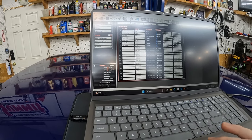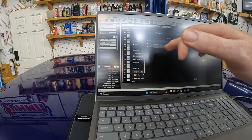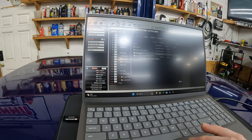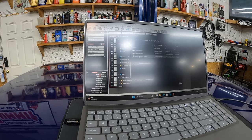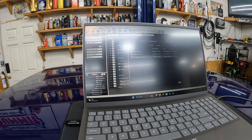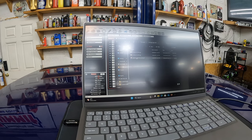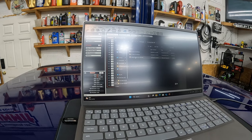We're going to open it up. You can see here I've got the USB thumb drive — this is the root and those are the two files that were in the Holley documents directory. If you go in there to firmware, you've got 'seven inch digital dash firmware' — that's the one I need. From everything I've found, you just grab both of those files, stick them in the root directory of the thumb drive, and then you plug that into one of those USB connectors. Obviously you need to plug the CAN connector back to the Holley dominator, then you turn everything on and when the screen comes on it should automatically find the correct file and load the firmware. If it doesn't, you can go through the options in the screen and update the firmware manually. Hopefully it will find it automatically, so I'm going to do that next.